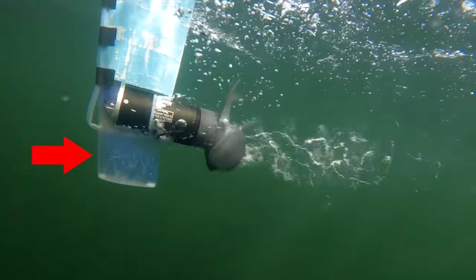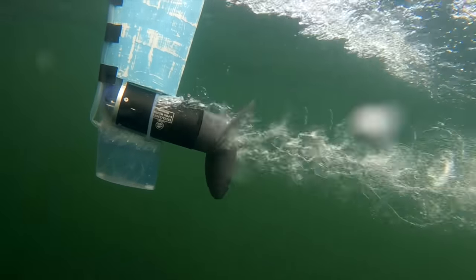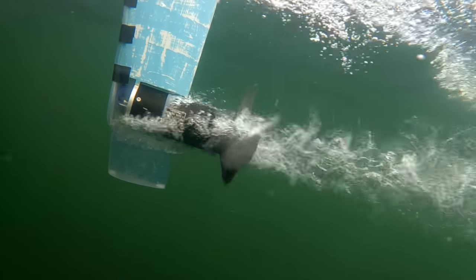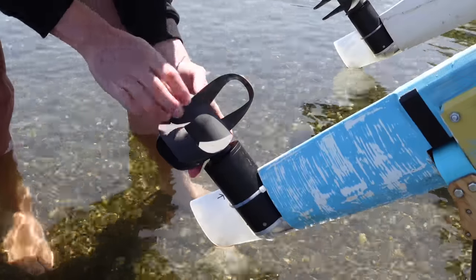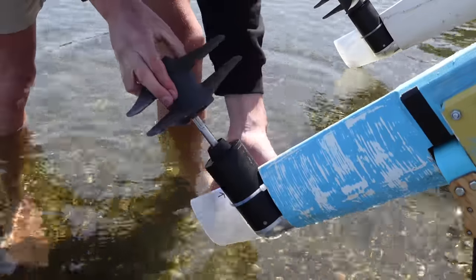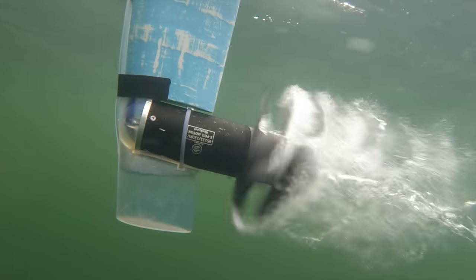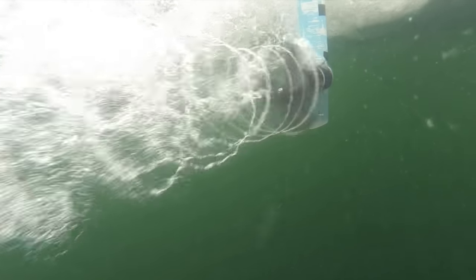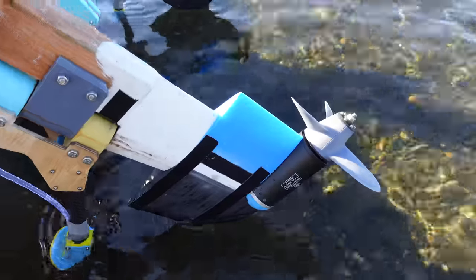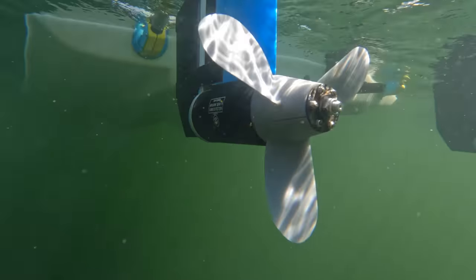As for the mast extensions that I added onto the motors earlier on, they didn't really seem to work at all. The vibration was pretty much unchanged with 2, 3, and 6-bladed propellers. Later on I did pretty much solve this vibration problem, and it wasn't by making the mast turbulence evenly distributed over the prop, but instead just by reducing the mast turbulence as much as possible. I'll talk more about that in a future video. That's it for now — thanks for watching.